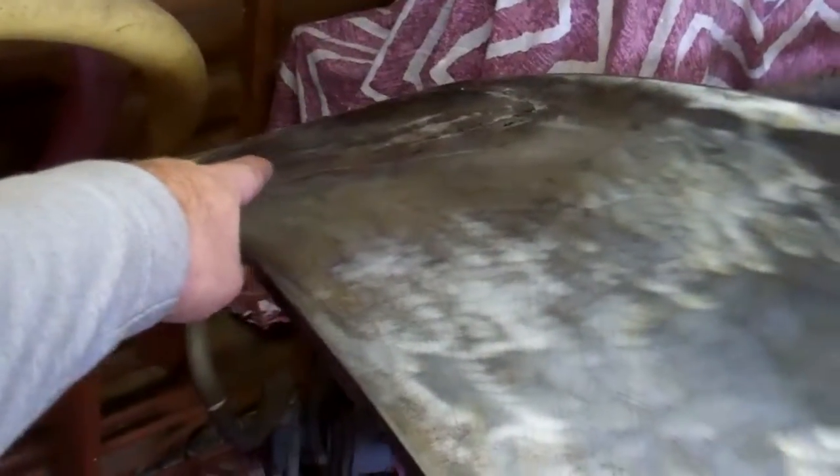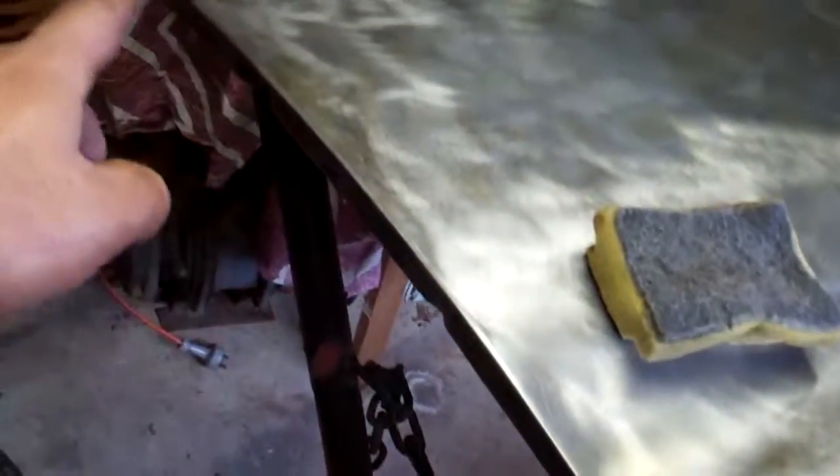I've got the outside all taken back to bare metal again, I've got all that surface dust off, I've re-washed it in vinegar water which is what I'm doing right now, and this time I'm going to etch prime it pretty much straight away. I've still got to do bodywork on that patch I put in the bottom corner, there's a little patch in the front corner. Every last bit of paint has been taken off the back edge - that took about half an hour in itself in these little spots, but that's all gone.